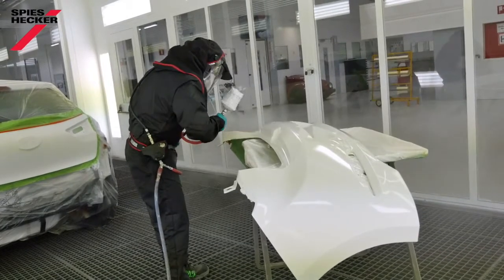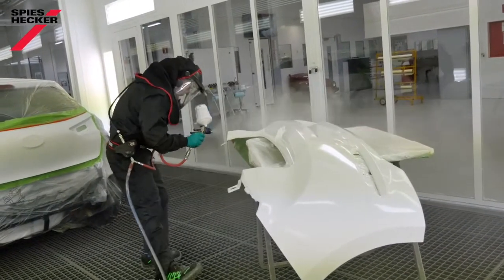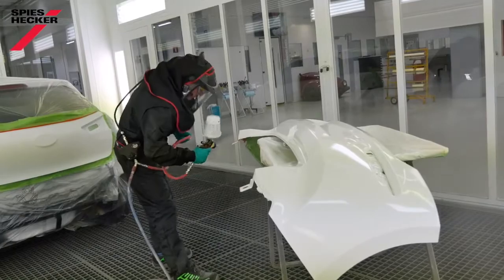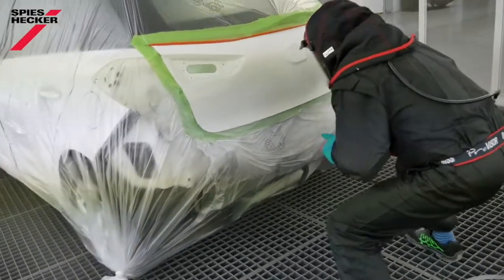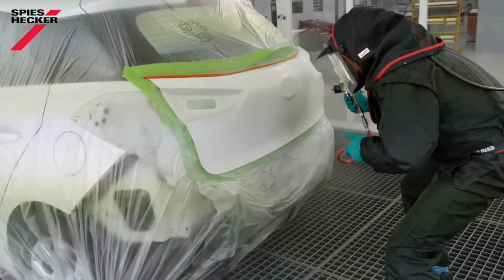Choose a spray gun that is in line with the recommendations given in our technical data sheet. Remember, too big a nozzle size will over apply the material and can lead to problems with splashing and defect formation in that way.